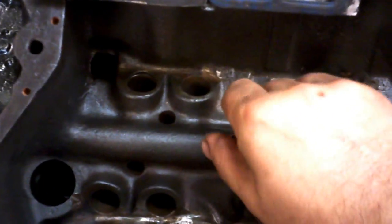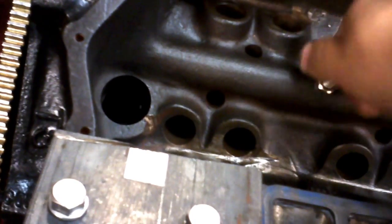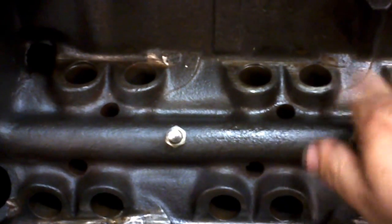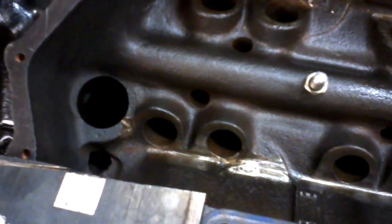In order to get the spacing right with the spider, it's necessary to use a nut. It just so happens that a regular grade 8 hardened 5/16 nut bottomed out provides the correct spacing for the spider. That's how you prep the block. And then obviously the spider would be held on by another nut.